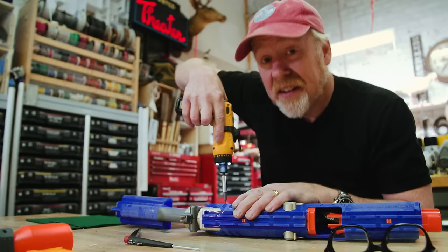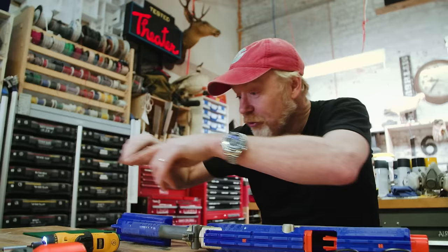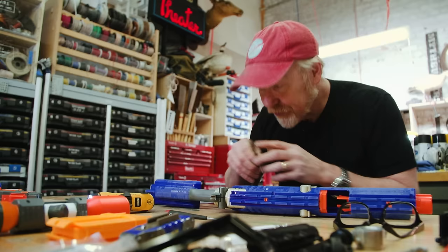Another thing that I've done along the same lines as this technique of lining the screws up clockwise from top left is I've also drawn a picture of the thing I was taking apart. I did a carburetor. So I drew a picture of the view of the carburetor with all the screws and I placed each one where it went on the carburetor. That was also very helpful.